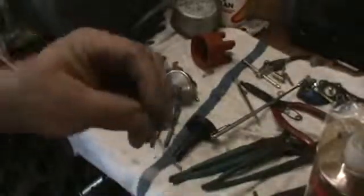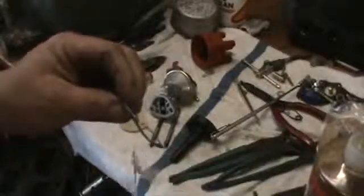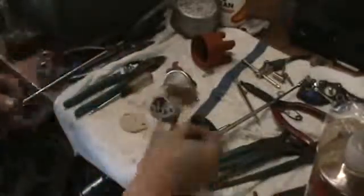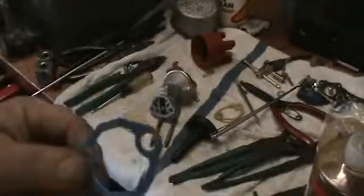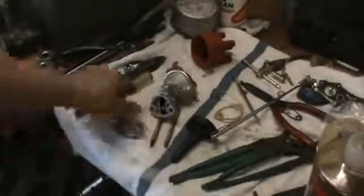Let me show you the comparison — this one's much more robust than this thin one. You've got to be careful; these will push out with silicone, so go light. I usually use the Aviation Permatex if it's that thin of a gasket. So here's our gasket combination — we're going to go with the short push rod.